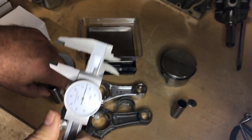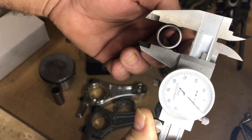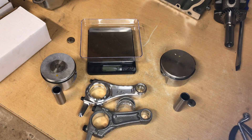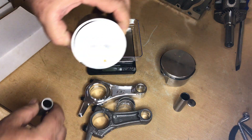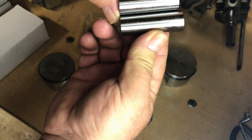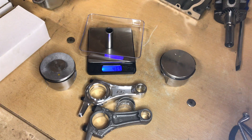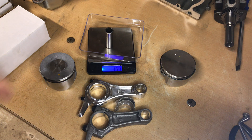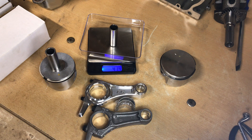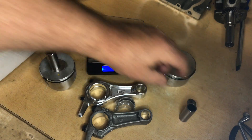Now these pins — this is the one out of the LCT 65mm bore, and this is the one out of the Wildcat Flat Top Piston. Both of these wrist pins are around 709 thousandths, and this is the one out of the LCT. Notice this LCT wrist pin is shorter, but it's also thicker. The LCT pin weighs 46.4 grams and the Wildcat pin is 41.4. So that's going to be in our favor.